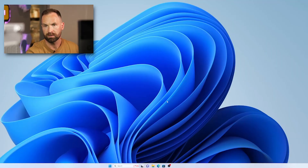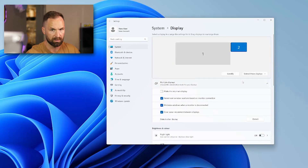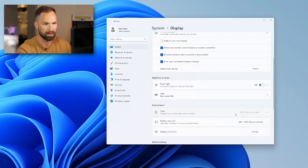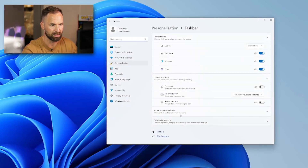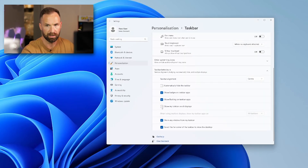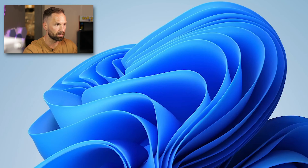The screen is all powering up, the PC is done and ready to go. We're just going to change the settings to put some details, some graphs, and a few performance figures. First things first, we need to change the orientation — go into the display settings, select the second display which Windows identifies automatically, change it to portrait, keep these settings. Then go to the taskbar settings, go down to taskbar behavior, and change 'show my taskbar on all displays' — turn that off, and as you can see on the screen it's gone, so the taskbar doesn't interfere.